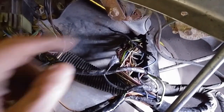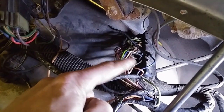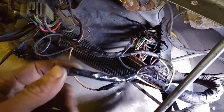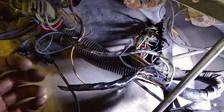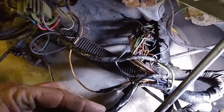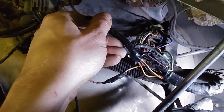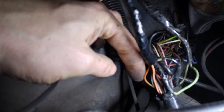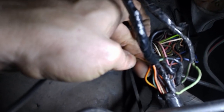As you can see, that's the connector for the computer — unplugged. In our case, I just unplugged all the wires that were related to the computer components that were affected. You don't have to do that because it's dead anyway, but it gives me a quick reference as to what went where and by color code. It's really tough to see, but the wire that comes up from the overdrive solenoid is the orange-green wire.